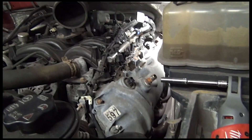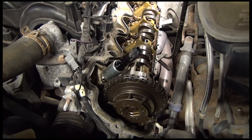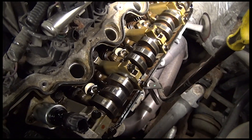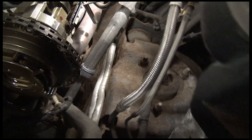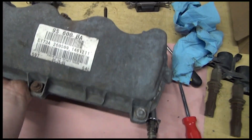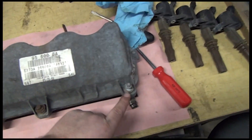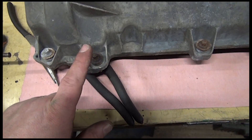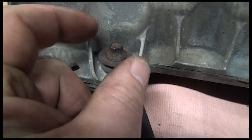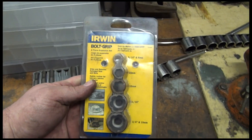I'm going to keep moving and get this valve cover off. We finally got the valve cover off — I had help show up. Down here you can see I have a socket hanging off of it; there's a bolt that goes up and holds the dipstick in place, and I had to reach through the fender well to get to it. The back corner bolt was stripped and rusted. The valve cover would have sat this way — this would have been the front, this was the back, and this corner was stripped. So I switched the bolts so I'm able to tighten them all down, but I had to use these tools to get it out. I'd rather it be up front where I can get a hold of it to tighten and loosen it.